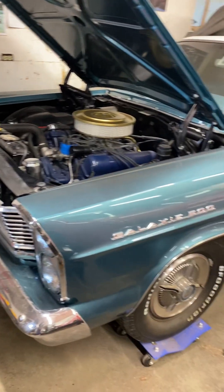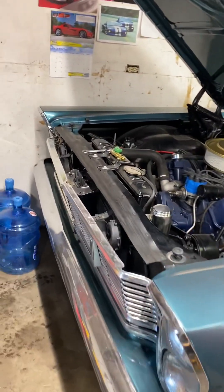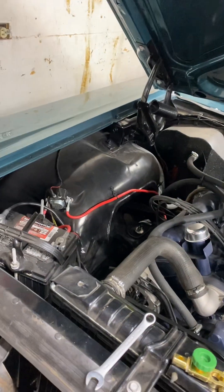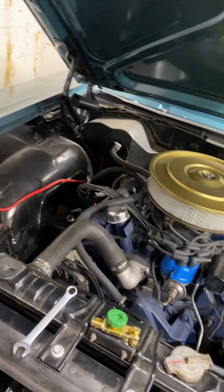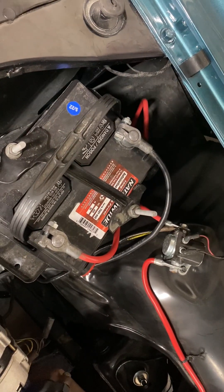Because we're not using it, I'd like to put a battery disconnect kill switch on it so that when it's not being used and it's just sitting in here, there's no drain on the battery. I don't have to keep recharging the battery every time because when you open the door the lights turn on, that kind of thing. We basically just want to eliminate the battery potential off of this.